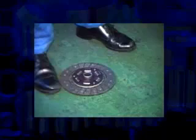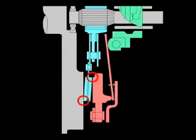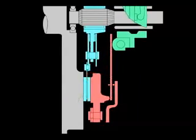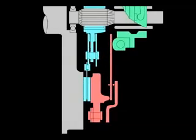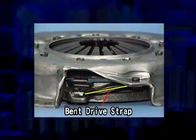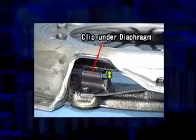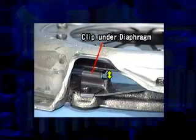The clutch is a very delicate component. If the clutch disc is even slightly damaged or deformed by mishandling, it will come into uneven contact with the flywheel or the pressure plate, preventing the engine torque from disengaging. The clutch cover must also be handled with care. If it is dropped, the clip could become bent, impairing disengagement performance or causing chattering noise.